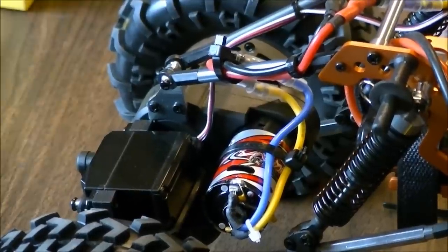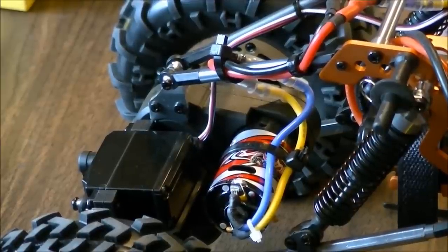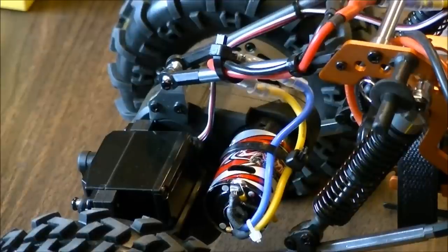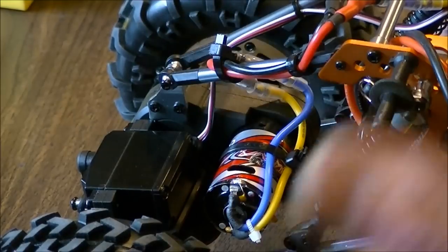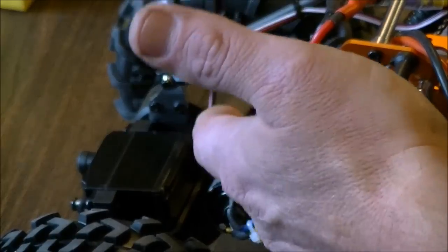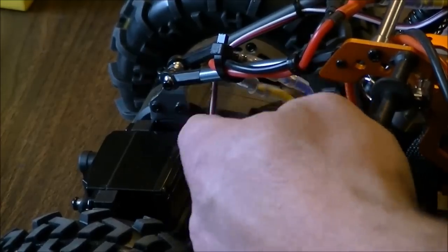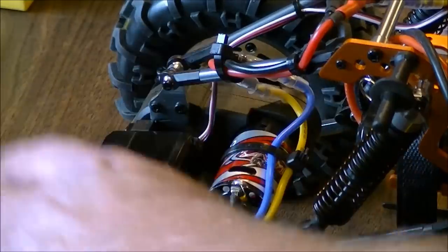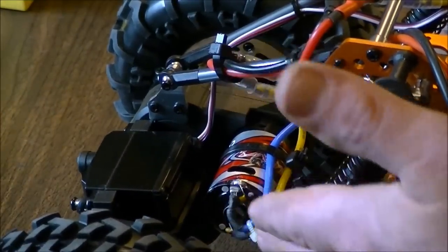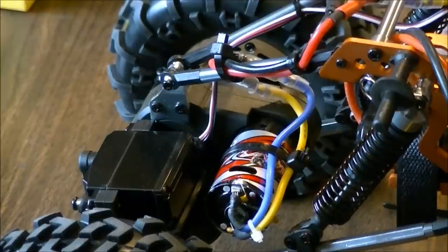Now it's the other side, and that'll be the end of this mod for this machine. I can unplug and I'm not voiding the warranty. I'm also avoiding any chance of the wires flexing outward — because even though my steering has been reduced to 85 percent, having the wires on this side of the post when they bulged out, there's still a chance my tire can rub. Strapping the wires across the motor definitely ensures they're not going to bulge outward on either the front or rear.